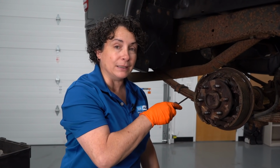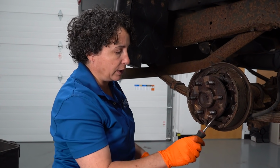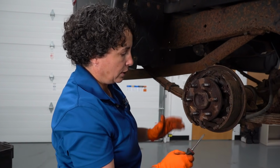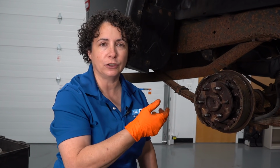Well, that's needed because if that's not there, it's not making an adjustment as you step on the brakes and these shoes expand out. It won't turn the star adjuster, which is your adjustment, which makes the pedal proper height, proper braking. If that's gone, this doesn't move, doesn't cause the adjustment, pedal starts going to the floor. Yeah, you don't see it right away because you are in it all day long, so you just live with it.